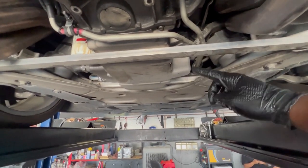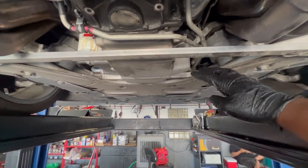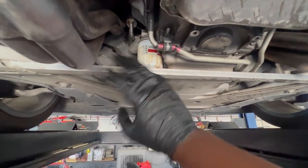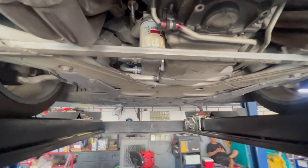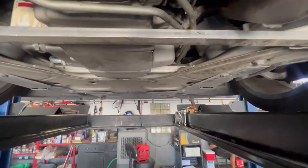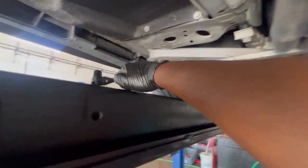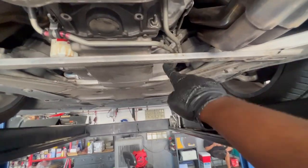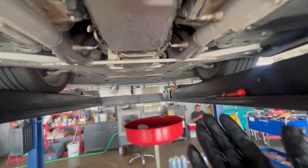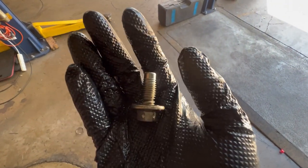Typically what you will see happen is it'll start to get thin around the area where it ripped and then it'll rip, but mine didn't do that - it just ripped. Now the reason why I was able to catch this is solely because whenever I do my oil change, I start with the drain plug, I finish up with the drain plug, tighten it down, and then I move on to the filter. Once I get to the filter and I'm done replacing it, I clean it up, make sure it's tight, then I double back and check the drain plug again. I went ahead and tightened it again after I was done with the filter and literally the head spun, so I was like wait a minute, I know I tightened this, let me take it off and see what's going on.